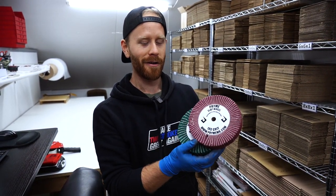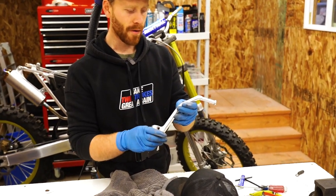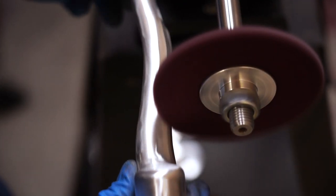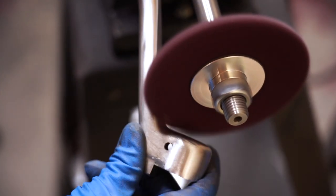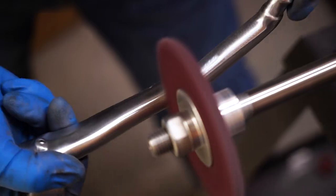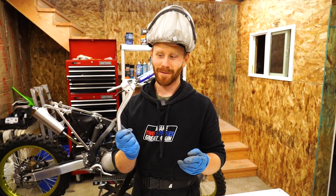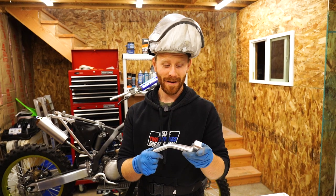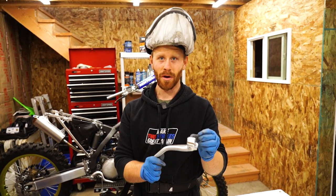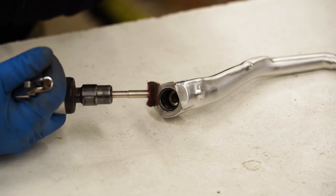These usually are a pretty hot seller on the freebie list. Last thing we've got to do with the kickstarter is give it a final brush — you can see it's a little inconsistent and rough in spots, so I'm going to hit it with the fine cleaning wheel to give it a nice consistent look. It's where I've been refinishing parts for like 15-20 years now and it never gets old — it always just looks so awesome every time you finish up a part. You could have just thrown it away but now it's perfectly functional and it looks even better. Now to clean up the inside bore of the kickstarter I'm going to use a little mini wheel on a die grinder.